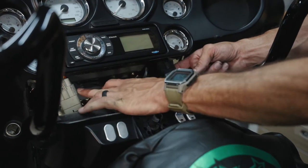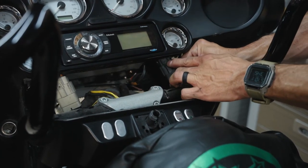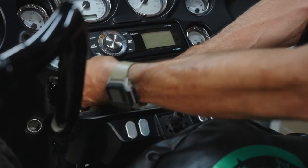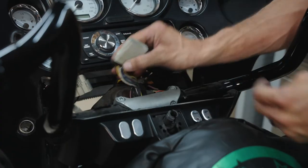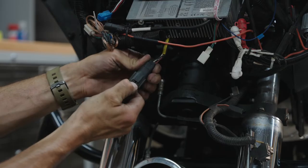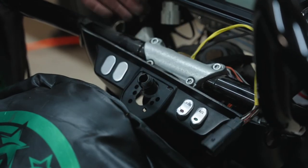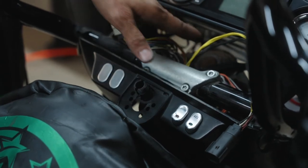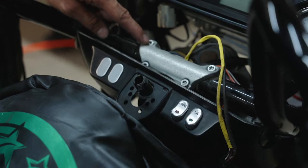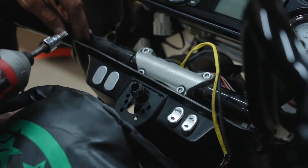If you're doing a stock setup, that's where you'll find your left and right switch harness plugs. Your throttle by wire plug will just be floating in this area. We've rerouted the location for these plugs, which allows us to install a set of 10-inch bars without extending the electrical. You've got one here, one here, and then our throttle by wire, which we'll unplug from the front. These just have a clip button — press it and it'll pop right out. Same thing on the other side. We'll go back to the front and get our throttle by wire — press the little clip button and pull right out.